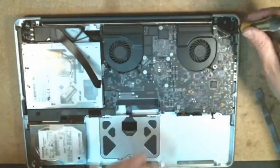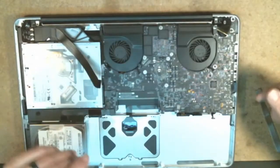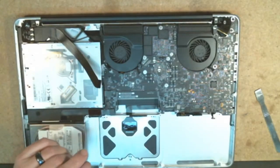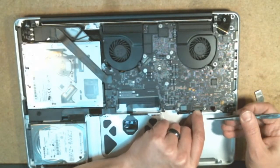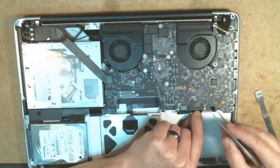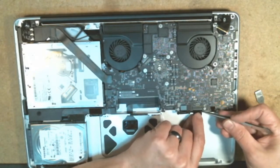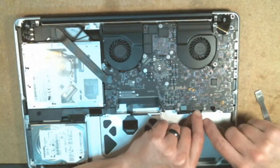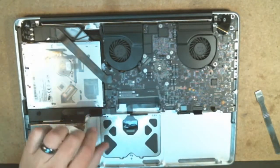So now that that second screw's gone down, I go ahead and tighten it, and then come back and tighten this first one. Now pretty much guarantees your alignment is proper. So once it starts going in, we go back and forth. A lot of these connectors that have the ribbon cables have a dotted line or a solid line across, just so you know that it's pushed in all the way. So press down on your ribbon connector there.